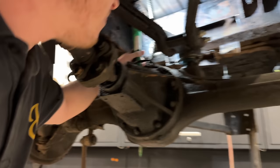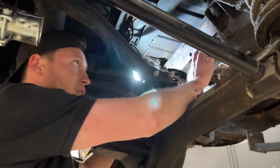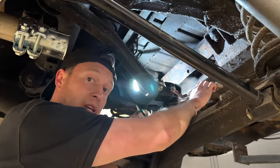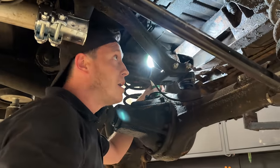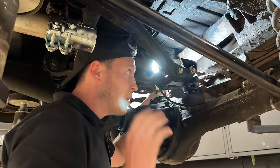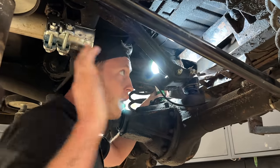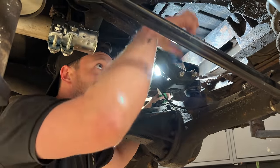So there was basically the fuel tank carrier bracket. It literally just holds the fuel tank. All behind here, it was totally rotten. And the only thing we can do is chop all the rot out, cut in a perfect template and save this piece before it goes too far. Luckily, this seems to be the worst of it. And a Discovery One chassis is usually pretty good. It's not like a Disco 2 where the whole rear half completely destroys. It's actually pretty good. I've done a little patch here.